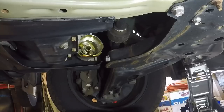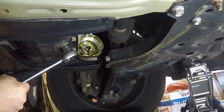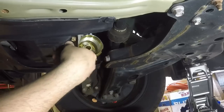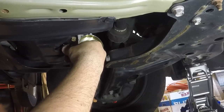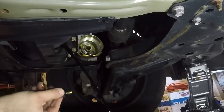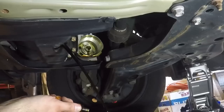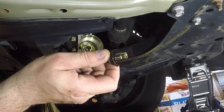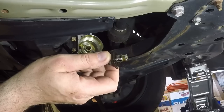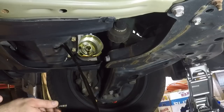Now that the filter housing is off, you'll need the tool to put it back on, so put that aside. Then you've got your 14mm socket for the drain plug. The manual says the car takes 4.4 quarts — definitely consult your owner's manual — but a 5-quart jug should do it. Before you crack everything loose, check for leaks. Some people replace the drain plug gasket every oil change, but I think it's unnecessary. You should be checking your car between oil changes to make sure it's not burning or losing oil somehow.